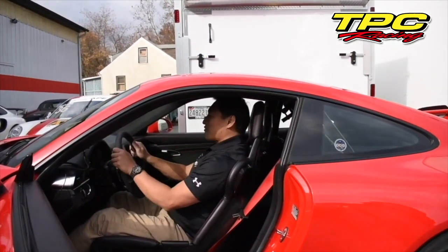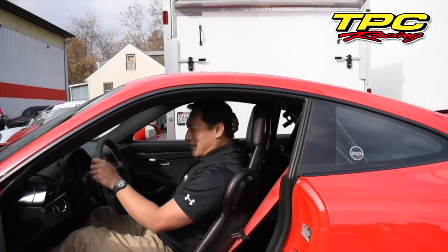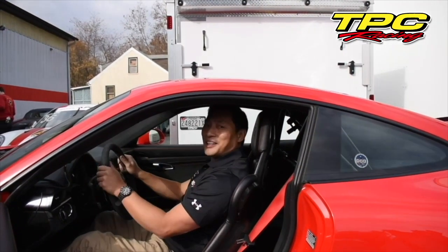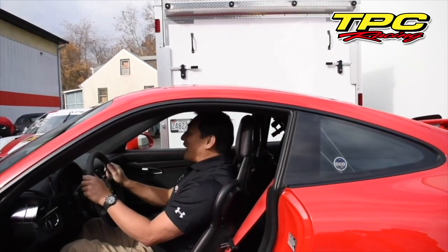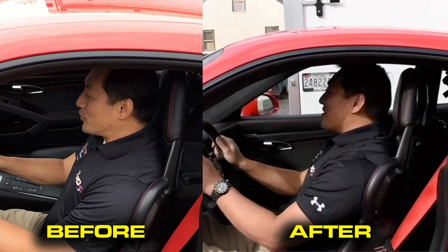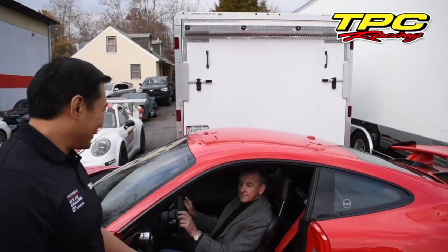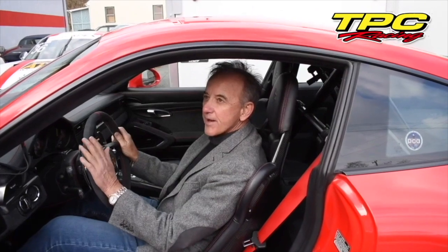With the bracket installed, I'm in my track driving position — this feels a lot better than before. You can see there's a nice gap back here; this air gap is going to be filled out by my helmet, my Hans device, and my elbows at 90 degrees. It's very ideal, and I can definitely see far and upward without having to try hard. Now let's hear it from the owner of this car who's done more than 50 track days in it: it feels more natural, it feels better — I can keep my eyes up much better than with the seat straight up and down.